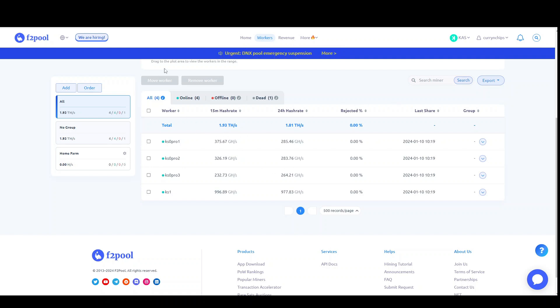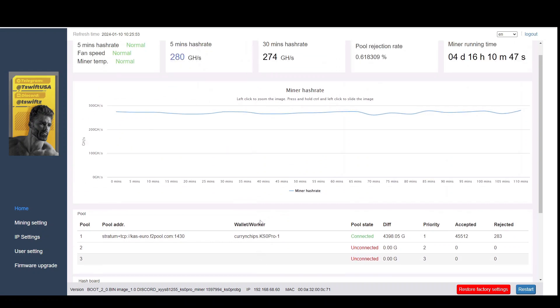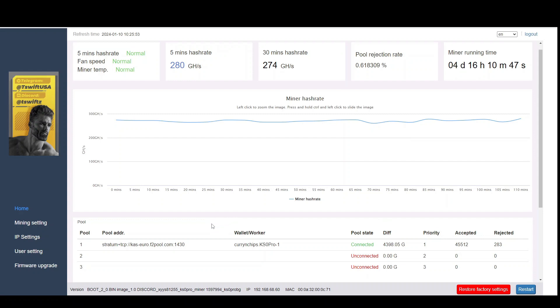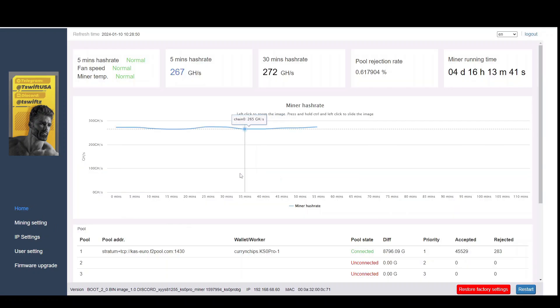In terms of reliability, I couldn't be happier — I think it's well worth the investment. Temperatures are good, it's running well. I will do another video on how to load the firmware if people would like. It's incredibly easy: you log into your device remotely, click on firmware upgrade, upload an initial file, restart the rig via the software, then upload your chosen firmware — whether the 280 gigahash one or lower. Every time you do that, check your pool settings have saved and make sure you reset the fan speeds under fan percentage, because it will change them otherwise.